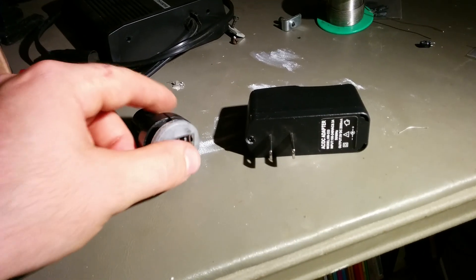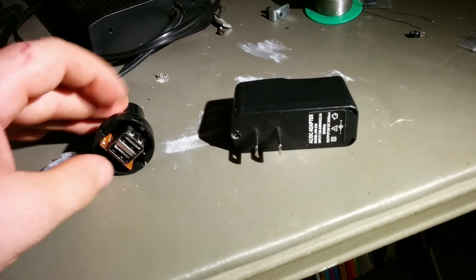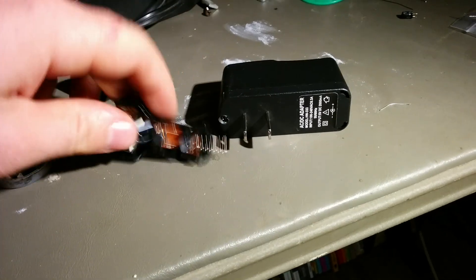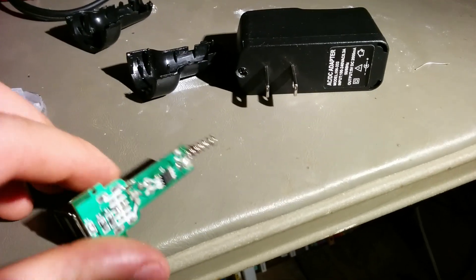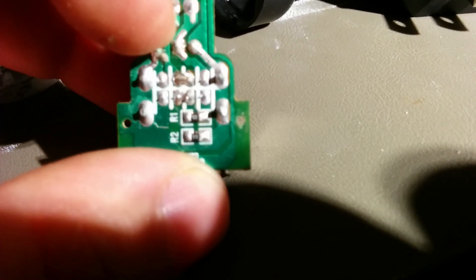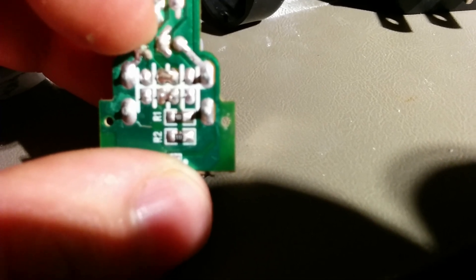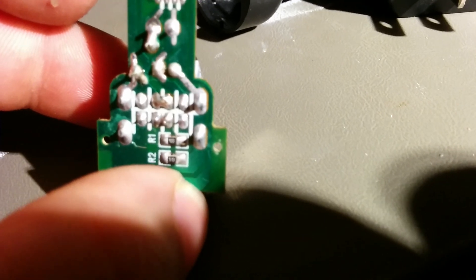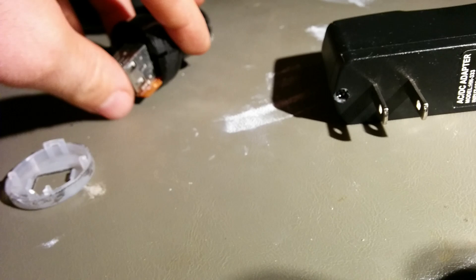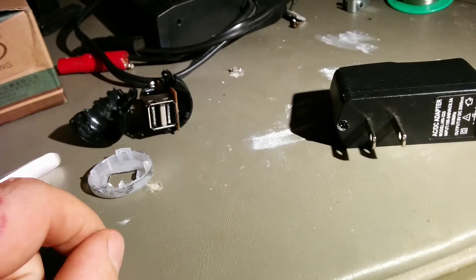So I've got two chargers here. These are easy to take apart and look at, and we can actually go in and solder the data pins together so that you won't get the low charging rate — you'll actually be able to get full speed charging out of these cheap devices. This one I've already taken apart. You can see we have eight pins together, and in the middle of both sets of four, we have a pair of data pins. I've already done this — those are soldered together. I just bridged it over with some solder. As soon as you plug this back in, it's going to signal to the phone that it's an AC wall charger and it can use the higher amperage.